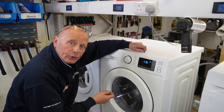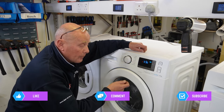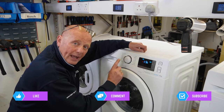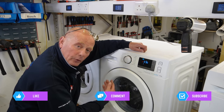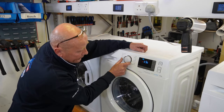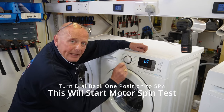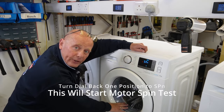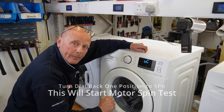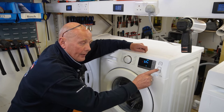Now there is another test to do with the motor. We can either empty the machine manually by pressing the pause button to stop the machine and then pressing the rinse button once to empty the machine, or we can rotate the dial back one so it shows SPN. This is the spin test. The spin test will empty the water left in the machine and slowly increase the RPM from 400 RPM all the way up to the maximum spin speed. On this machine it's 1400 RPM, and all you need to do to start that is press start again.